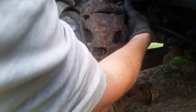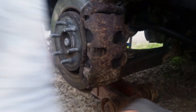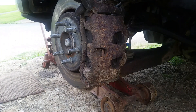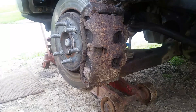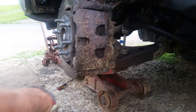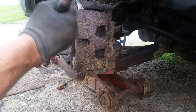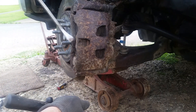We got that one out. It's got some slight grooves in the rotors. We're gonna try to get this caliper off here - oh boy, no go. I'm gonna have to get a pry bar. Maybe if we rock it back and forth a bunch of times it'll come off, but that's gonna be tight. Let me get a breaker bar and hammer. Always wear glasses because when you're hitting this rust it will fly back and get in your eyes - see all that rust flying around.